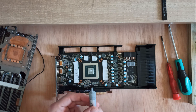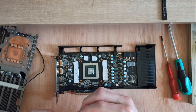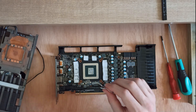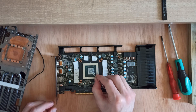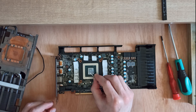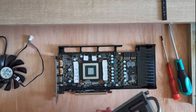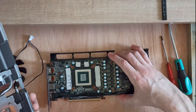So that's promising — a good indication that we've got a genuine one here. If it was reballed, it's probably as good as any other second-hand chip. It's the memory on these that tends to go. We've got good pads touching the memory from the heatsink, and it even extends to those R16 components. I've heard it's the voltage regulators that need cooling. These RAM chips look fine though — the pads are good. I'm not going to disturb them; testing and use will be the judge of whether the memory is good.